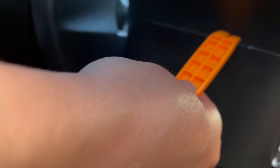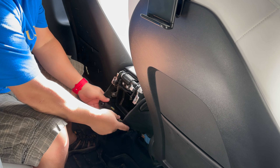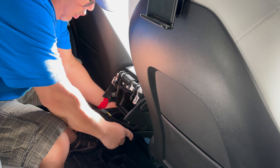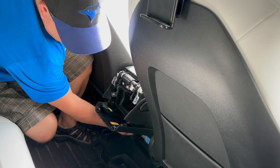The next thing to get out is the bottom panel. All you do is take the orange pry tool that's included and start from the top — though I find it easier to just get your fingers underneath at the bottom between the panel and the carpet and pull it out from the bottom. Then get the top part off by pulling two hands here, pulling down and out. Don't forget there are two little screws down here you have to take out.